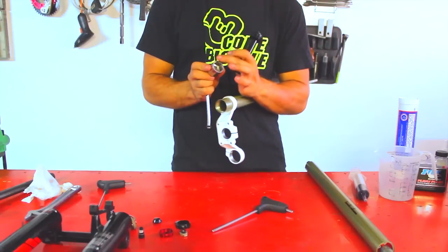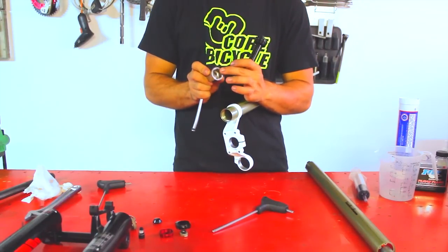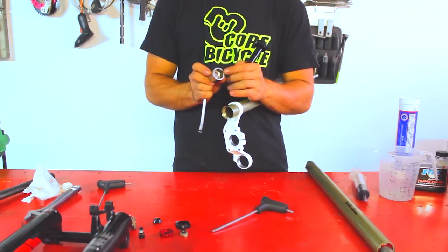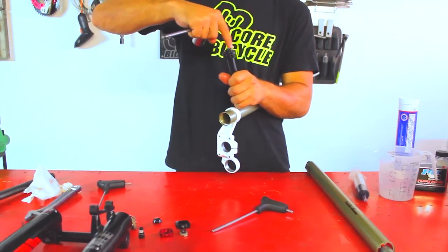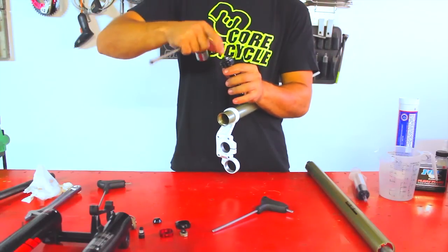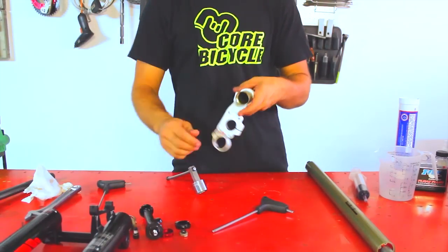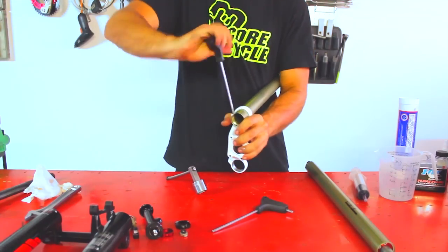It's important to lower the front end of the 24mm socket with a lathe or similar so as to keep it totally flat. Standard sockets have a step and it's possible to damage the tube cap if the socket slips while loosening. Now you can remove the lower crown.